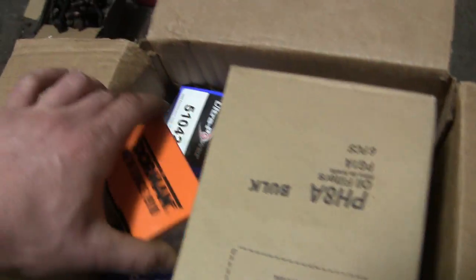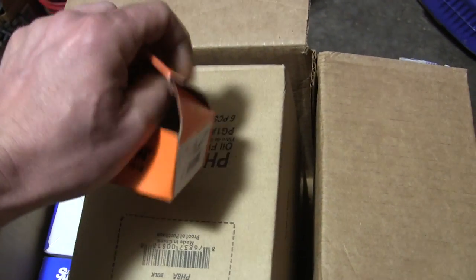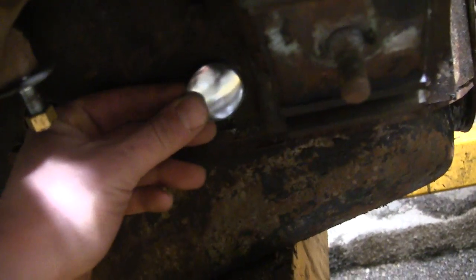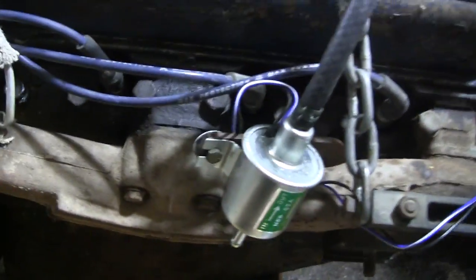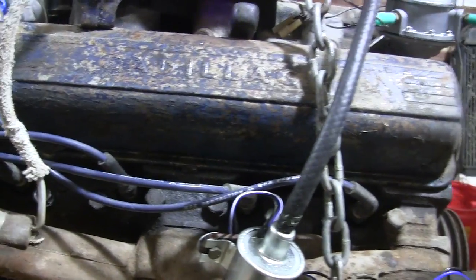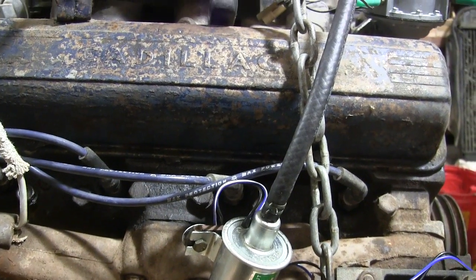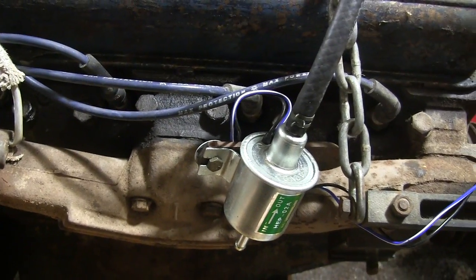Unfortunately, I bought block plugs. I got the 1.5 inch, ordered those up, and they are just a hair too big. By a hair, I mean about literally a hair, because they won't quite fit in there the way they should. Just ever so slightly too big. And as it turns out, I did some research on this thing, and these ones, rather than 1.5 inch, take 1 and 31/64 plugs. So I've got to order them up, so I've got some time.